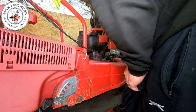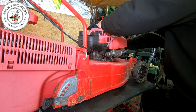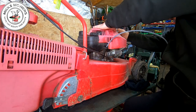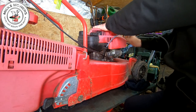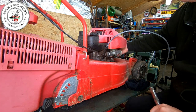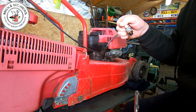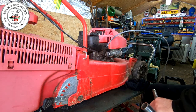Get some gunk off as well because there's so much gunk on that engine, which I can air compress off a bit later on. It's running okay by the carburettor. I want to see it run with a new plug in it. I'm going to disconnect the HT lead, get the plug out, and put a new B2LM in there. This plug's well old — it's got a B2LM in there but it's well corroded. That goes straight in the bin.